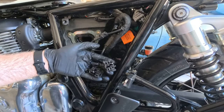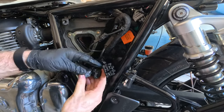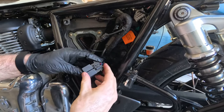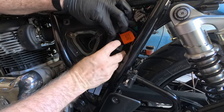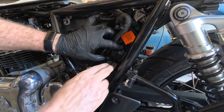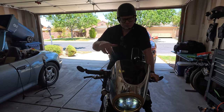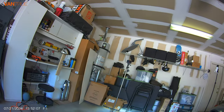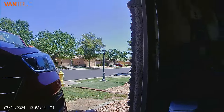I got these connectors pretty clean, and I got the new relays here with just a very light grease on them to keep them from corroding — even though I don't expect much corrosion in this desert climate. These things have little slots and tabs so they just slide right back into place. Let's try this again — it started! And you can even hear, over the loudness of my bike, the dash cam starting up with its little voice notification.